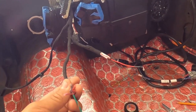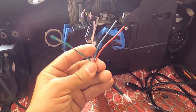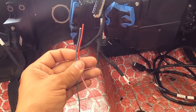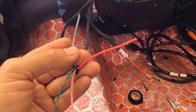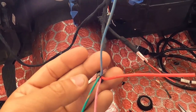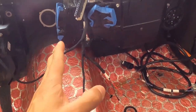On the other pigtail off the body harness, you've got your park neutral safety switch, ignition source, and an auxiliary red wire for constant power if you want to add power to something else. Then this light blue with tan wire — that's going to be for your starter. Whatever starter wire you've got coming in, you hook up to that and it'll start the car. That's your starter relay wire. You've also got a couple grounds coming off this harness — make sure you ground everything properly.